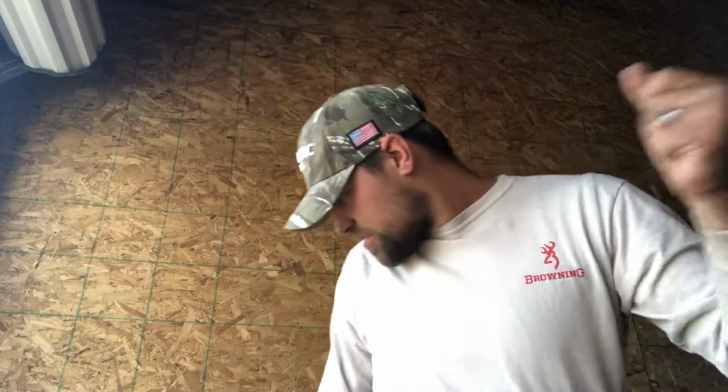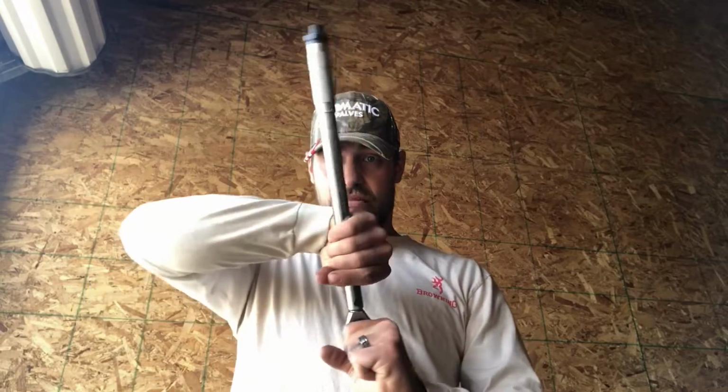Okay, I talked to Tom Marana about how much to torque these head bolts. They're basically the same as the bottom end main bolts, so we're going to torque them to 75 foot-pounds. Stock would be 55 foot-pounds, and then you wait 5 minutes, and then you torque them 90 degrees. That's from here to there.